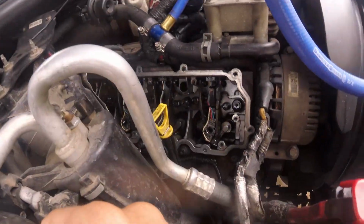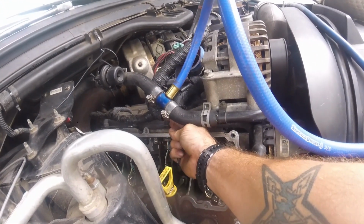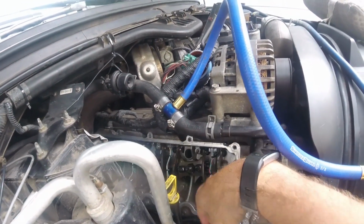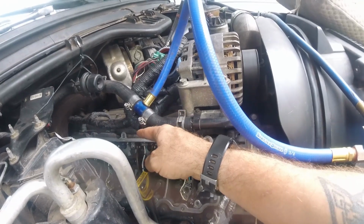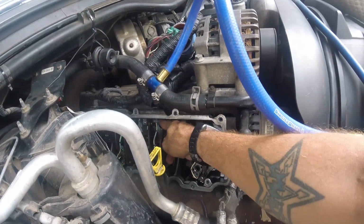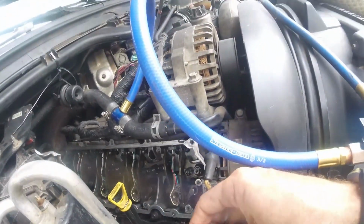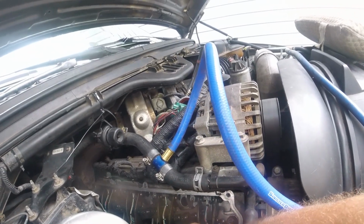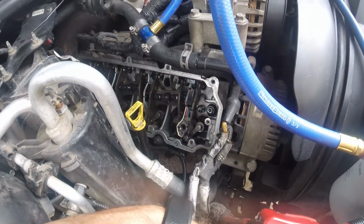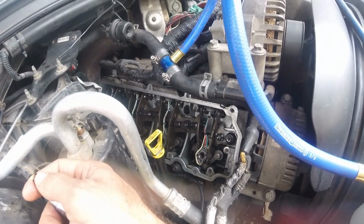So we're back over at the truck now, and we need to unhook the injector harnesses. There's a little clip you just pull out a little bit and it pops right off. And then there's a socket trick. You could put a socket over it and get it to come through. Alright, and then it's T40 to loosen up the bolt for the injectors. So let me get started on that and I'll be back.